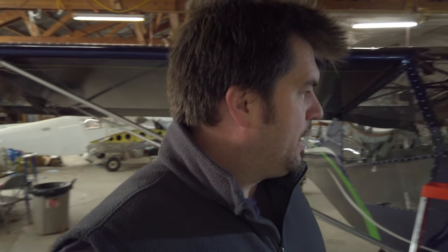I didn't lug this motor, which meant that under full power, even in a steep climb, my RPM was right at red line. But with the tougher case, you make a little more power, you have to add a little more pitch, which means it's going to lug a little bit more when you're cruising, but it's not such a big deal because the motor can handle it. So there's a lot of things that will come out of this will be better.